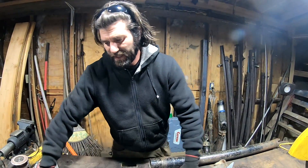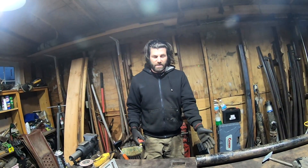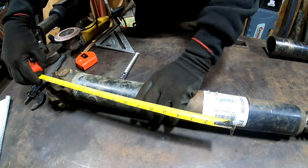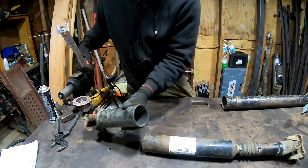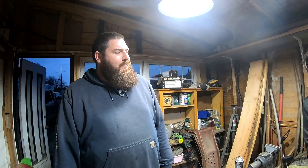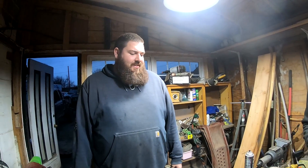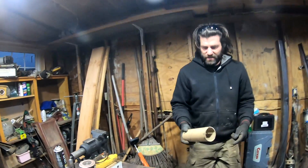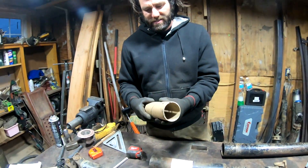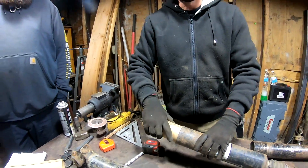What do you need that for? About to show you — calm down. What we're going to do is make a sleeve that'll slide inside this. It's not gonna fit? We're going to cover that. I think about a foot would be good. What's always in there? Cardboard. And Ogre's here — can you tell us why there is always cardboard inside these drive shafts? I would assume it's probably for dampening of some sort — like vibration dampening or sound. Look how weird is that. See what's in the other ones — look at this little guy right there. See how that's cut? When you slide that in, you squeeze it together and it slides in nice and tight. That's what we're going to do for this piece of tubing.